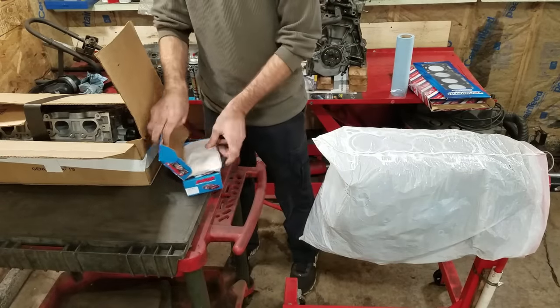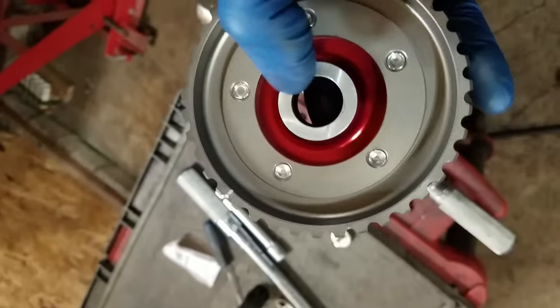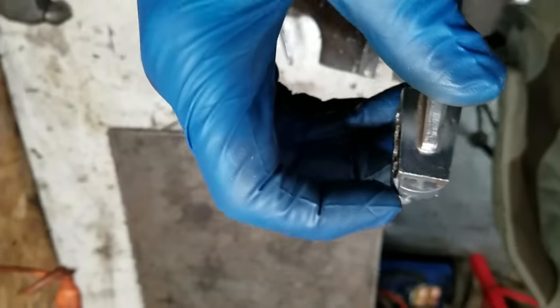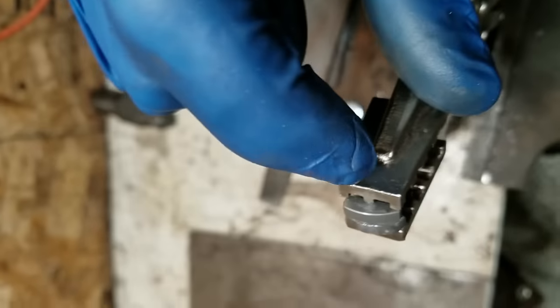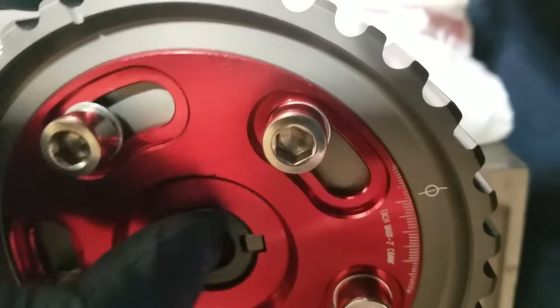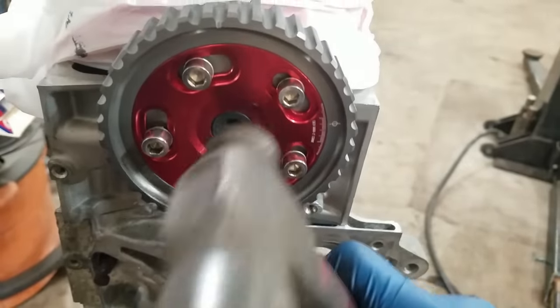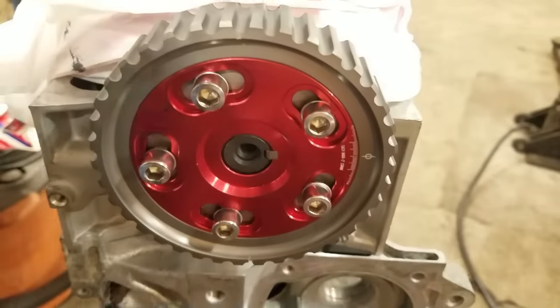I got some ARP head studs and carefully put the head on. I got my camshaft sprocket back — cut the back of it. The key doesn't fit quite right; I got a Honda key from the hardware store. I clamped these two together and filed it down ever so slightly to get the right profile. With the stock key there's all that slop, but with my aftermarket one — once it's in, it's not going anywhere. Probably the only guy with an aftermarket eBay cam gear that's actually going to work the way it's supposed to.